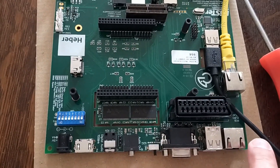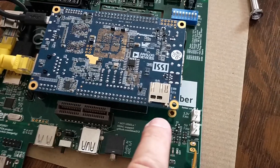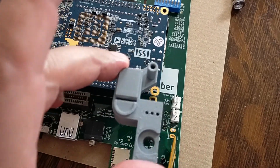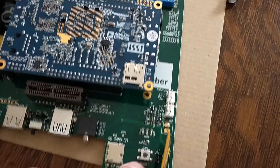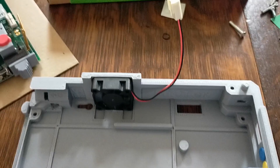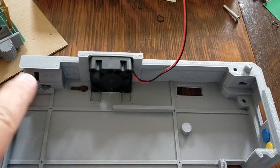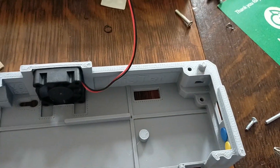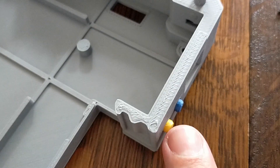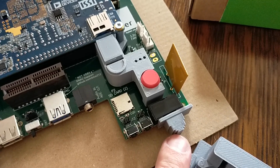Routing your cables, you've got to be very careful. You connect it to your motherboard, then flip it over and plug it in. There's a little gap for the adapter for the power switch, and also the reset button. It's also got a little slot for storing an SD card. Moving on to assembling the case: you've got to fit a load of nuts into the various locations, screw on your fan — two at the back and one at the front. The fan is 5V but can be run at 3.3V. Then there are these little 3D printed buttons that just drop in, plus a reset button and on/off switch.